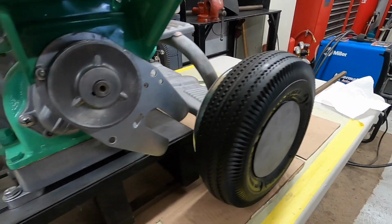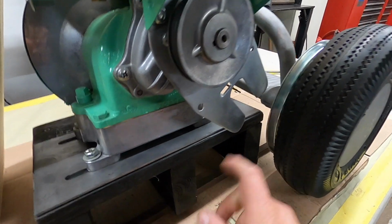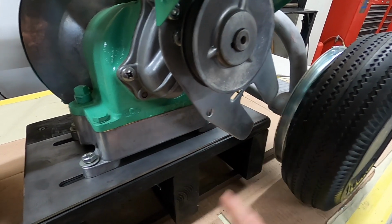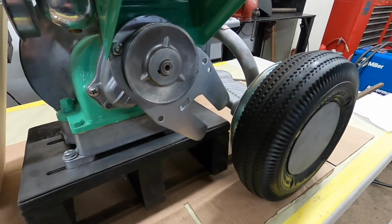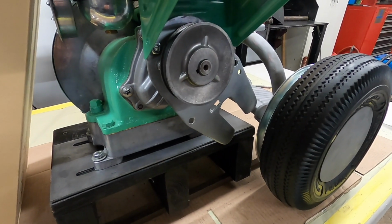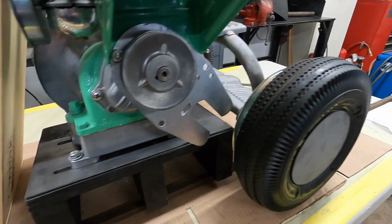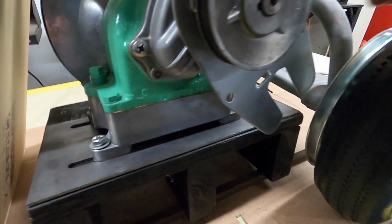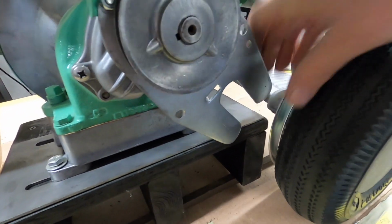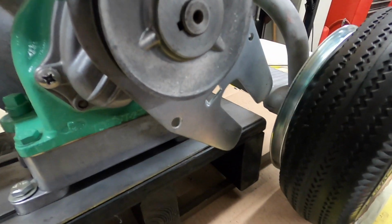And I'll have to tack the axle to the frame, tack this to the axle. And I might have to notch a little out of there. And if I do, I'll tack it there, and then I'll tack the engine plate to it. Make sure everything's nice and square to the axle. I'll use a T-square on the axle to this. Oh, and I also measured from the V pulley, the V part of the pulley, to there, and that was 1 1/16.